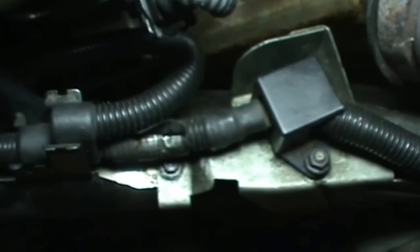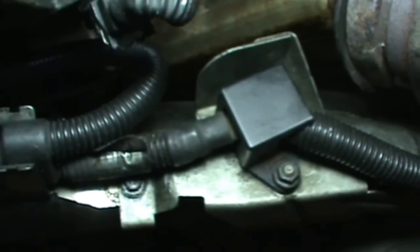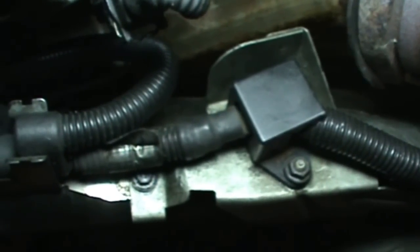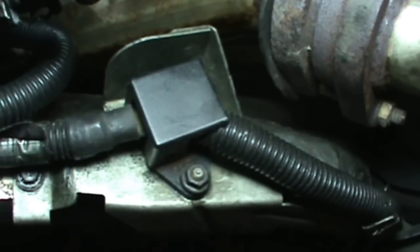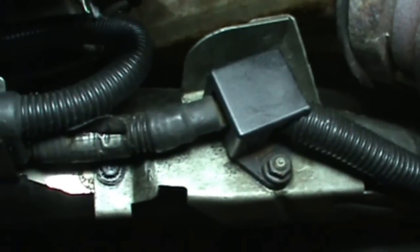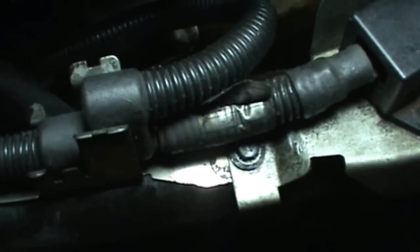Really the most difficult part of this job was getting that screw in that's right there in the center. There are three pieces of sheet metal that come together, and they all have to go through that hole and then it's mounted there. There's a piece that holds this junction box right here, there's the heat shield that I installed, and then there's a wrap that goes around this frame support that holds this line, this bus line. All three of those pieces come together right here, and that was fun.